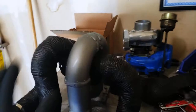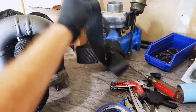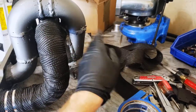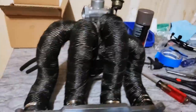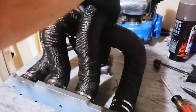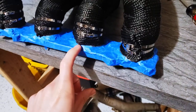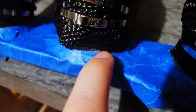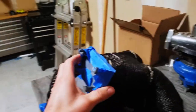Got three done. Starting the last part, but of course I don't have enough wrap. I don't want to order it because it'll take forever — hoping AutoZone has black two-inch. No one sells black titanium exhaust wrap in stores, so I had to wait on Amazon. Several days later, the wrap came in — only took a couple days, Amazon is shipping much quicker now. Got it all wrapped up and now I need to mask some of it off and spray the high temp silicone. I left a little gap on all the edging of the wrap so it will hopefully seal everything in. It's all wrapped and ready for paint.